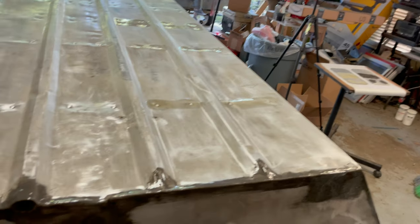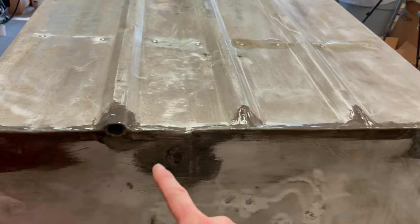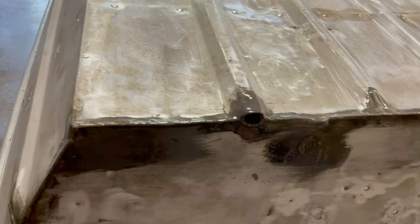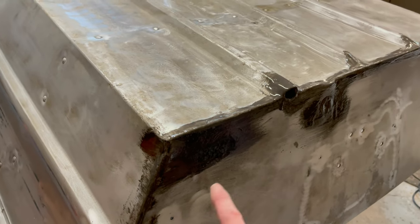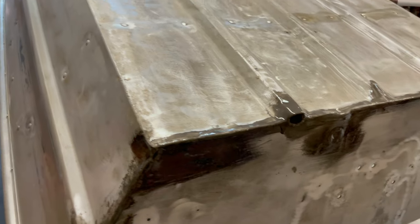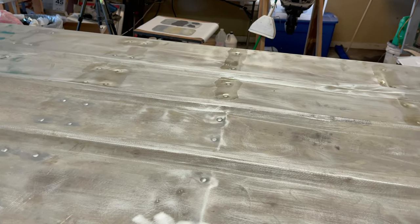After doing the little test, I had some of that coat left, so I did the back bottom part of this boat just so I wouldn't waste it. And it does not sag near as much, but it will sag some, so keep an eye on it too if you're using the coat, because both of them are going to sag on you, but that Gluvit is just a little bit thinner and has more chance to run.